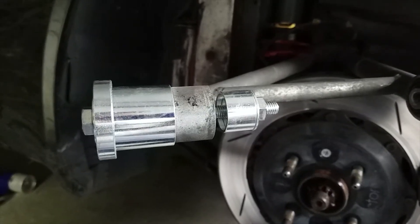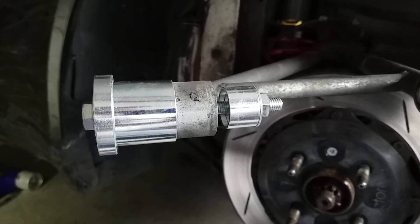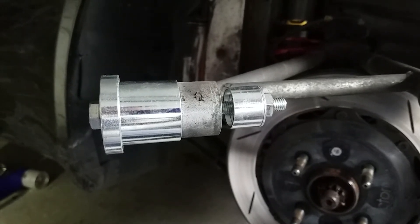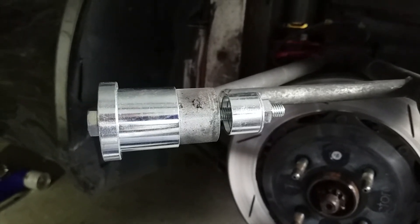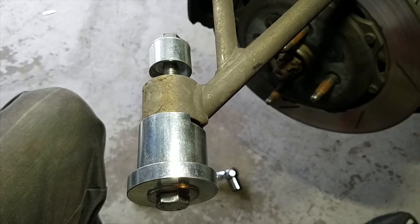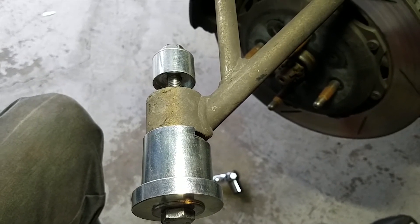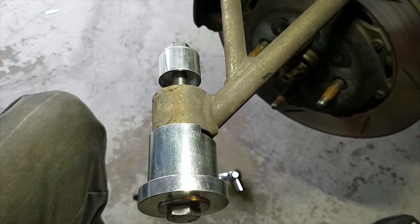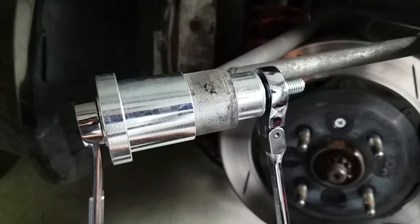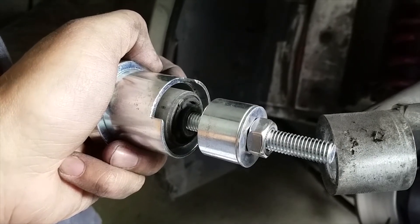To remove the bushings I've purchased this bushing removal tool — it's pretty cheap, around $30 from Blackwatch Racing or several other vendors that sell something similar. Having the proper tool is almost always a good idea, so I recommend it. The proper assembly has the cupped portion inward on the small part and the notch towards the arm on the large part. Simply tighten the nut until the bushing is pushed out into the cup on the other side.